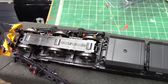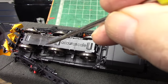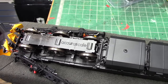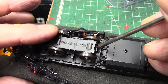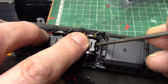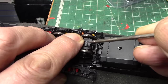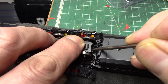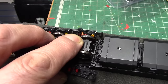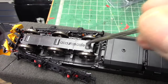Right, I've done all three wheels. I've got the base keeper plate. It's clipped on nicely at the front. It's clipped in on these four at each side. And now, just at the end there, you can still see it sticking out a little bit. I now need to press down a little bit and maybe use the screwdriver. Let's have a look. And just make sure that she goes behind. Push down hard on it. You can hear the clips. There we go. You see, it's gone in underneath the thing now. So that is all securely attached.